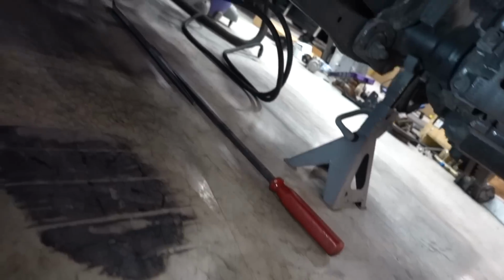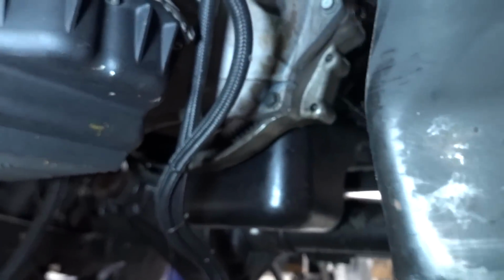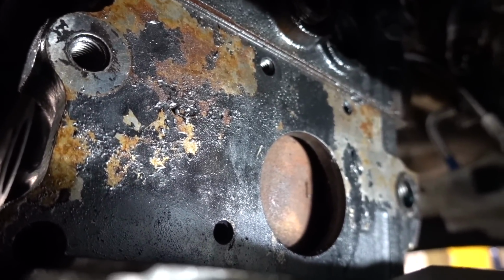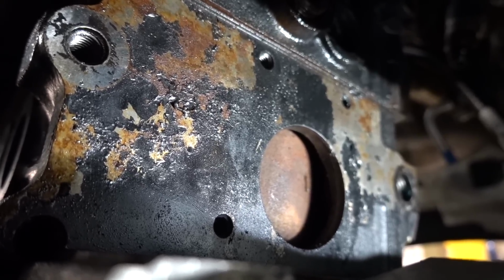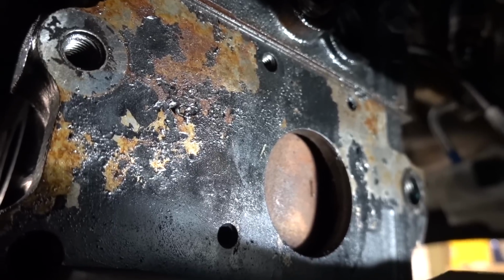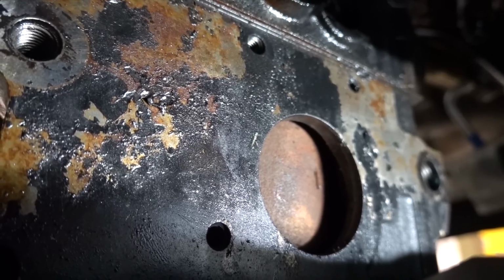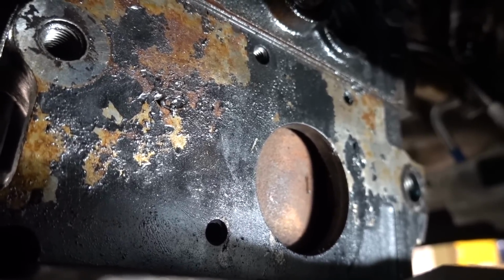The next big step is, you don't want to cut the O-ring going in with the bypass. So looking at the back of the engine here, you've got your plug out of the back. What you need to do next, instead of just trying to slam in that coolant bypass with the O-ring, is take some of that red Scotch-Brite that probably comes in the kit and clean up that circumference and get all that buildup. That way when you push that O-ring in, it doesn't get cut right away.